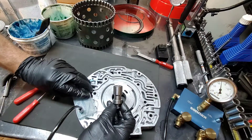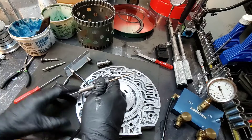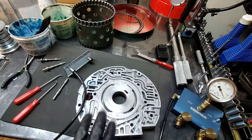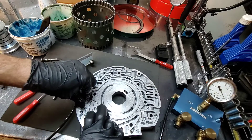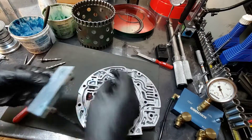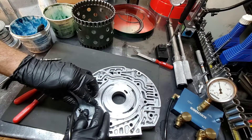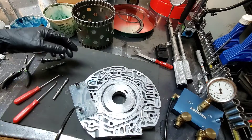The one I'm installing is the Tow Pro, which has a larger diameter boost valve. The original one that was in there — let me test it and see what it looks like. Checking this boost valve: 18 is considered good. This one has 20, so this has more wear than that one. The first one was a known good boost valve — I can use that on another unit.